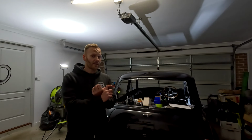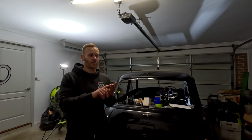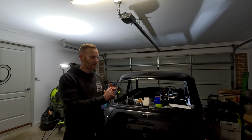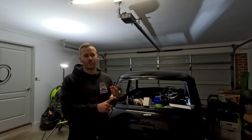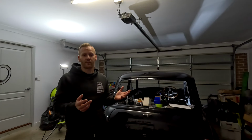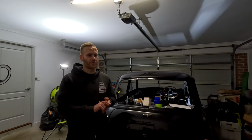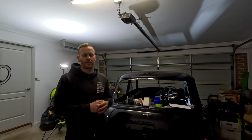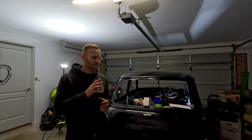You can use a pressure bleeder, you can use a vacuum bleeder, you can use a two-person method, you could even just use gravity, or you could just use something like a pipe going to brake fluid and just pumping the brake yourself. So all these means you can do either with yourself or with someone else. With this, I tried almost every single method that I was able to get my hands on.